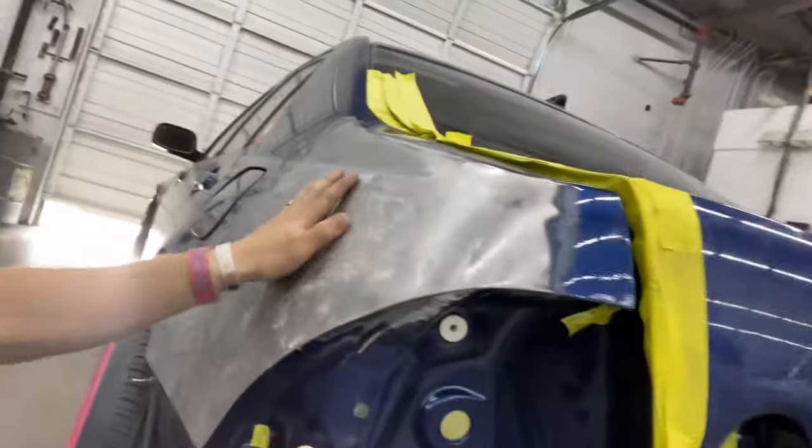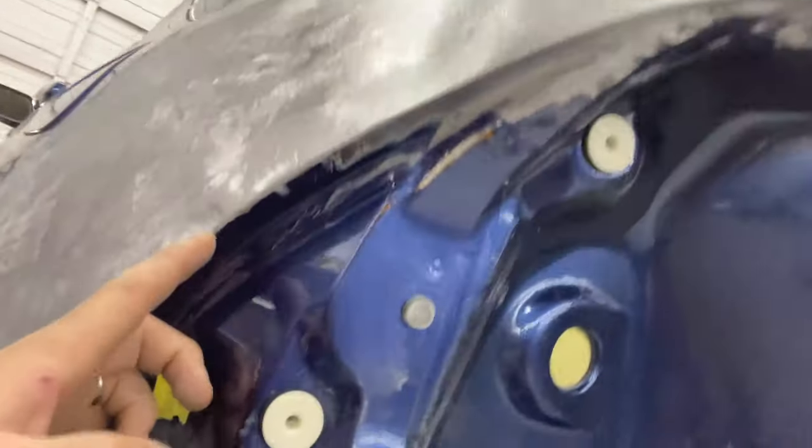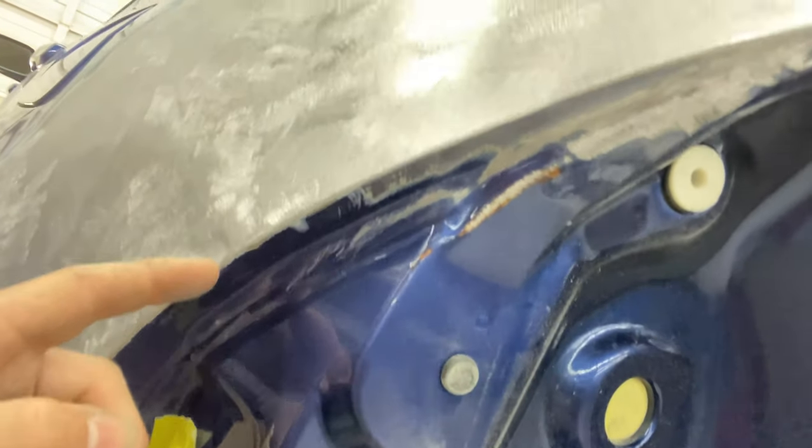I've had it sometimes where you're doing the Bondo, it came out, pop, and it goes back in because it has memory. If you don't do something to counter that, like take the tension off of it, it will go back to that. Just to let you know, this is a little dicey. It split the seam, so I'm going to have to pull this out. This is probably going to tear. I'll have to weld it up, grind it flush, get it low, smear it.